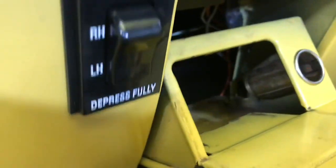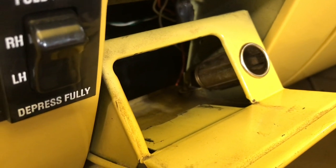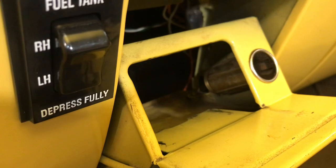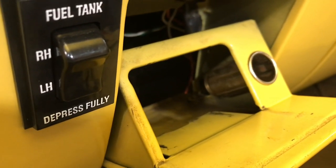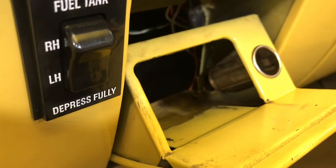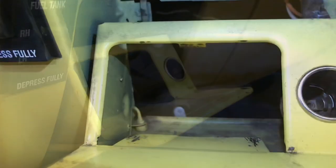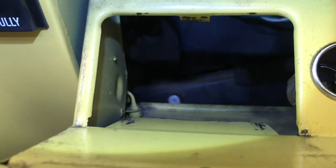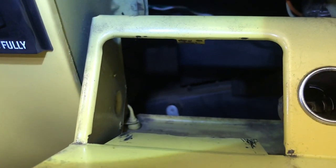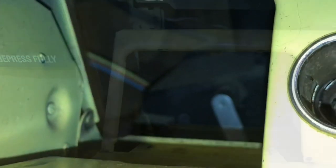With your ashtray center portion removed, you can see two tabs back there that you need to bend up. You can change the cigarette lighter as-is, but if there's corrosion or you have air conditioning and can't reach underneath, it's difficult. The tab I'm talking about is on the left and has a rubber bumper painted body color — there's one on either side. I'll take a large screwdriver and bend those up.